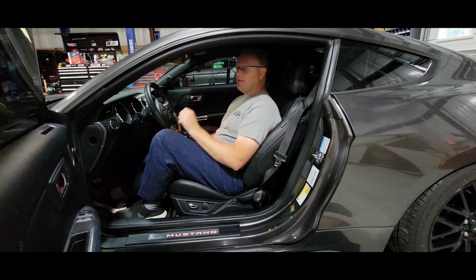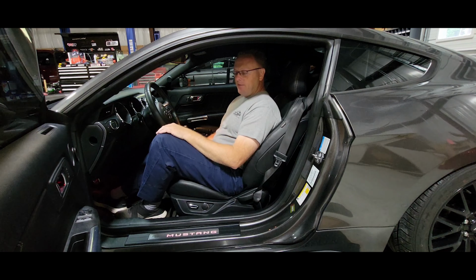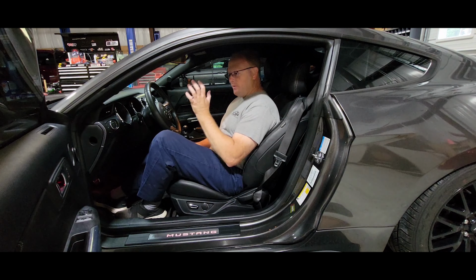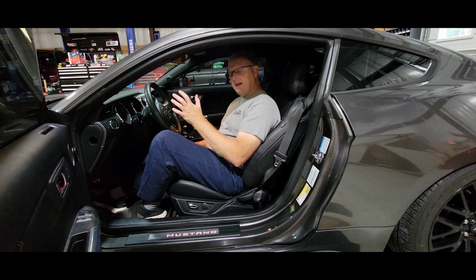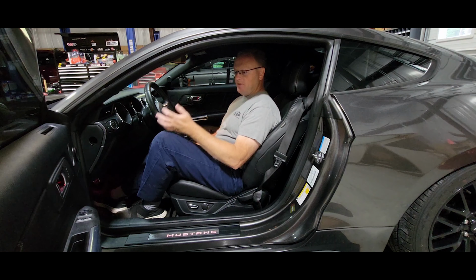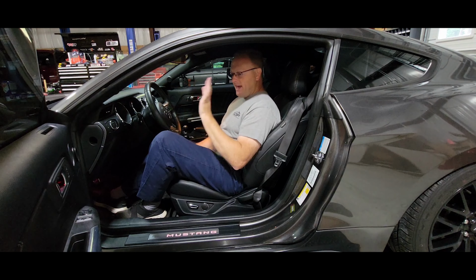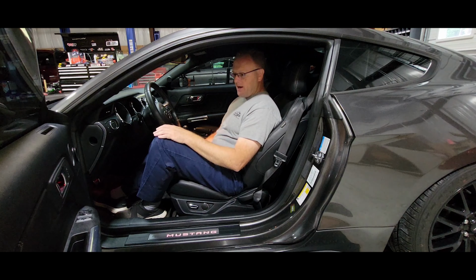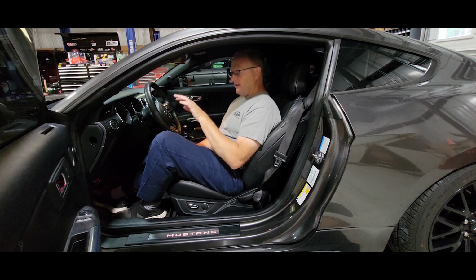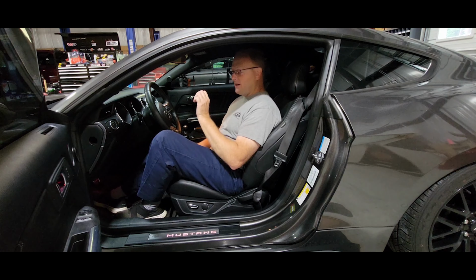The pros and the cons. The pros is it sounds really, really cool. The cons is, well, you know, it's causing a misfire at idle. So technically, if you do it a lot, it can be harder on spark plugs. It can be harder on catalytic converters. But in defense of that, if you're not going to let the car sit there and chop and chop all the time just sitting there at idle, as long as you drive the car and mix things up, I don't see any harm in it. It does cause your car to use more gasoline or E85, whichever fuel you're running, if you let it do it a lot. But other than that, that's the only con I can say. And like I said, the pros is it sounds really, really cool.